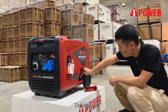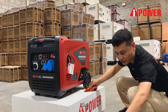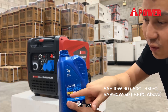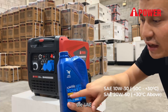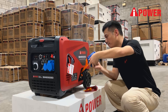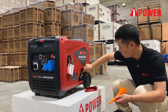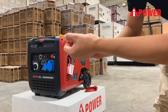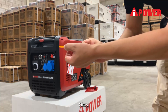Remove this button here. The engine oil we are using — the weather is very hot, so we use 20W50. Here in June in UAE we use 20W50, around 0.75 liters. We can use this to test; the position normally a little higher or a little lower is okay.